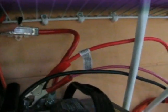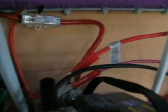The red line comes down here and feeds into a car fuse that I picked up from Walmart — that's a 100-amp fuse in case something was to go terribly wrong. Then I've got it connected to the positive terminal on my regular car battery, which I also picked up from Walmart for about 80 bucks.